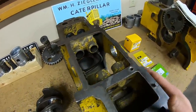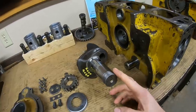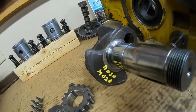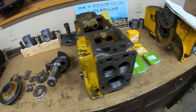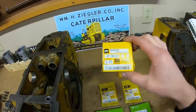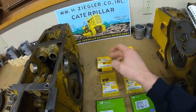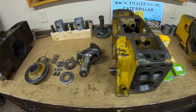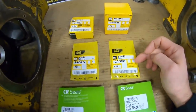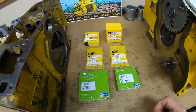So we've got the first of the tri-build blocks cleaned up, ready for reassembly. All that honing grit is gone. Here's the crankshaft I'm going to use. It has a fresh 20 thousandths undersized grind on the rods and on the mains. All that's been miked and verified. Here's the new bearings — 20 thousandths undersized on each. Here's front main bearing 4F9413, here is rear main bearing 4F9416. Both of those have been verified and checked against the clearance specs for that crankshaft.